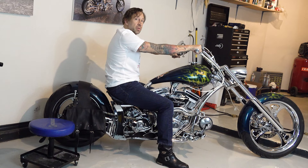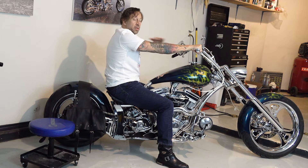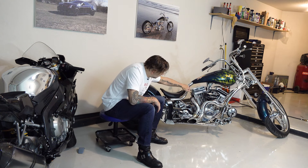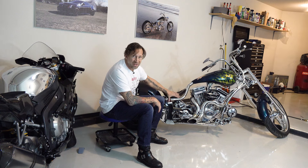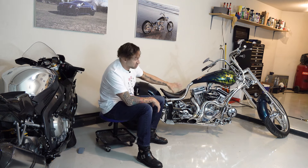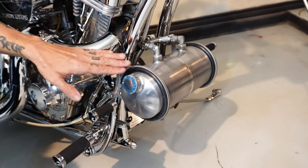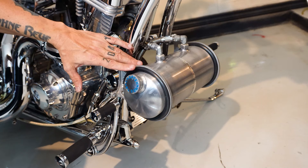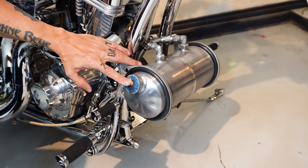You can see the drop seat on this one — pretty close to the ground. So when you sit on it, even though the bars don't look that high, they're almost level with the shoulders. Because it has such a low seat, the oil bag that came with the frame is actually a reduced capacity, and I didn't like that idea, especially with this big engine. So I installed this bigger Moon Eyes four-quart oil bag instead, and I put it right out in front where it'd catch that airstream and keep it cooler for the bike.